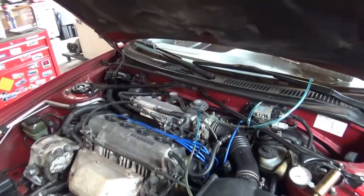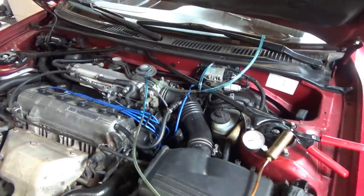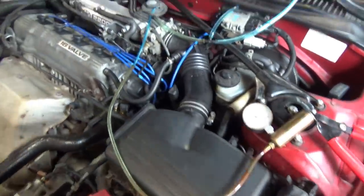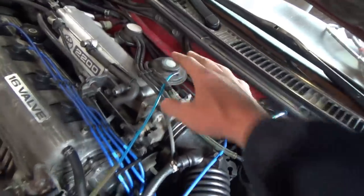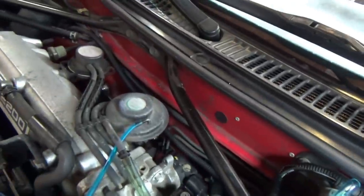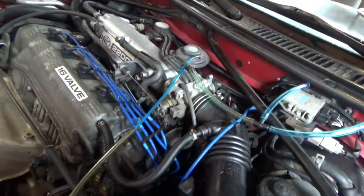Let's get back to this EGR system. First thing I'm going to do is start up the car, just pump up my vacuum pump that's connected right to the EGR valve. Make sure that works, that it stalls out. Most likely it does. You can even pump it up right now and then release it, and you can hear that the valve is moving.